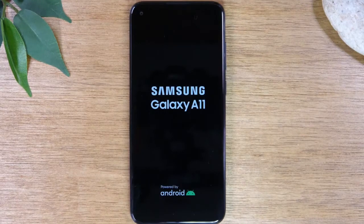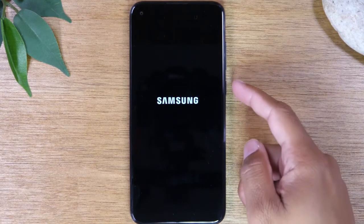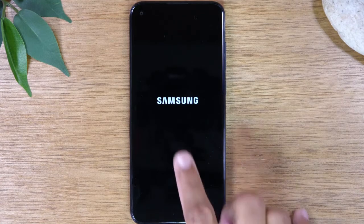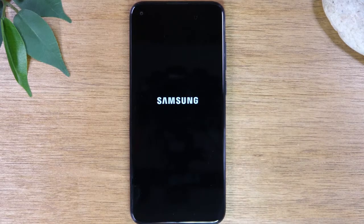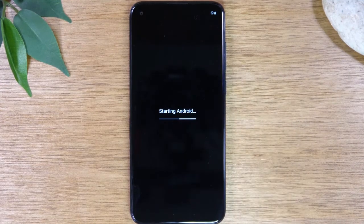This should take no more than about 30 seconds to a minute. Now if you notice your phone is stuck on the logo, no problem — just hit the power button on the side and that should kick you past the screen to the startup screen. In a few tests we noticed we got stuck on the Samsung screen for about three minutes. All we had to do was hit the power button and then 'Starting Android' popped up on the screen.